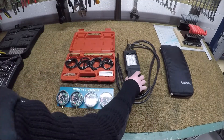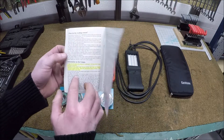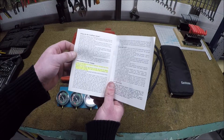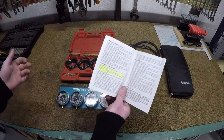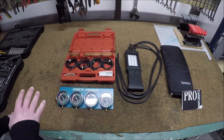One of the things that Morgan claims, and I've been going through their manual, is that the gauges do not need to be zeroed or calibrated — all parts have been matched at assembly. Damping of the gauges and friction of the rods may be slightly different in each column, but this does not affect the final readings, only the amount of time to get there. So no calibration required on that thing.